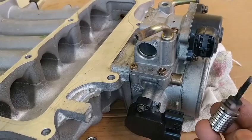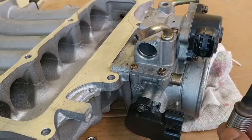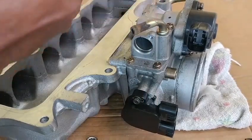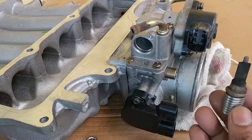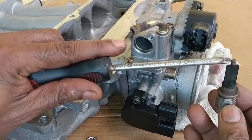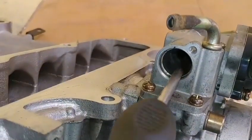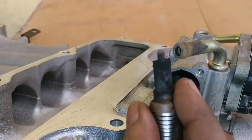Okay, so this is a thermo element spring which is sensitive to engine coolant temperature. When the engine is cold, this thermo spring will basically retract this plunger away from this port, promoting flow of coolant through these two spouts. Once the coolant reaches maximum temperature, which will be engine temperature, the spring will expand, pushing this plunger forward. And this little piece right here, this plug, will basically insert itself on the other side of this port. On the inside here, when you take a look in there, you're going to see there's a port for this valve to shut off and open.